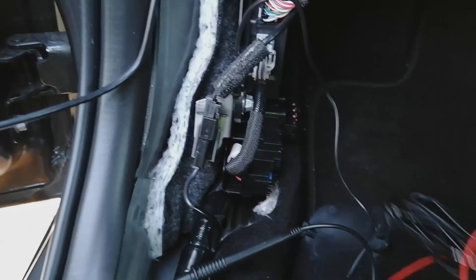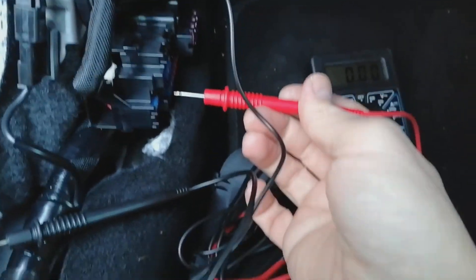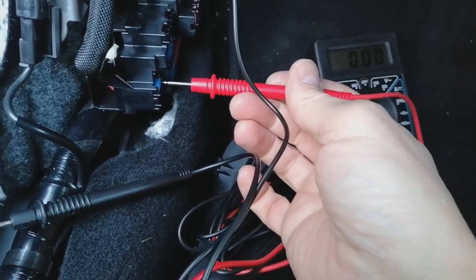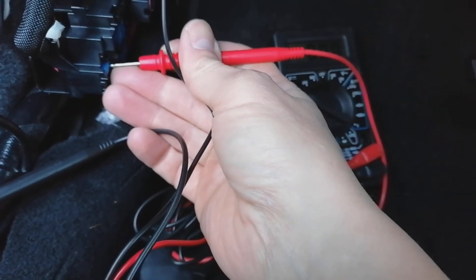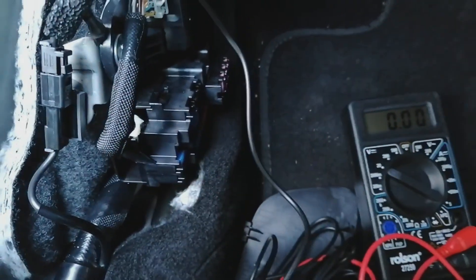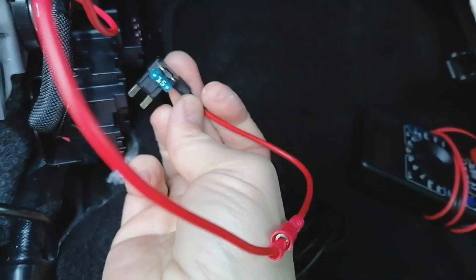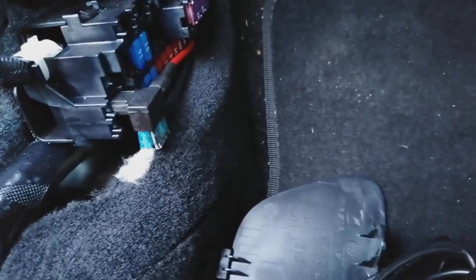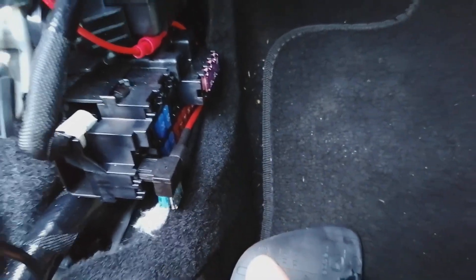What we're doing now is earthing out your multimeter and using the test probe or test probe screwdriver. We're going to use an accessory fuse — something like the radio or something non-important, not ABS, ECU, or ignition. With the ignition off you'll see zero voltage; turn the ignition on and that fuse will light up with 12 volts. With the ignition off, grab that fuse, pull it out, pop it into the fuse spur, and then pop that back in where the fuse came from, paying attention to the orientation so that power travels through correctly.